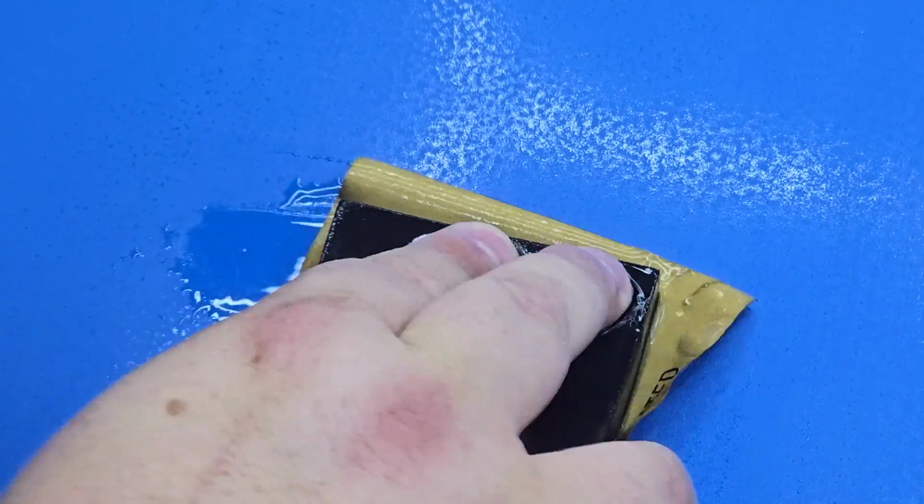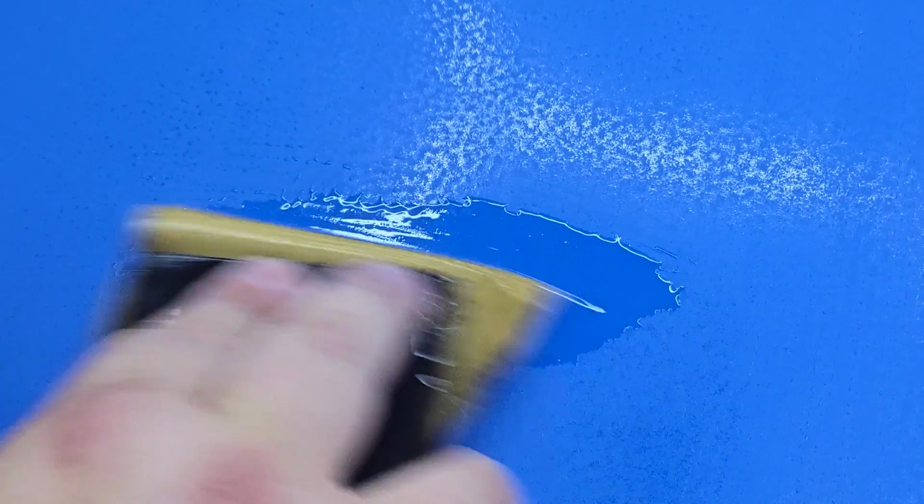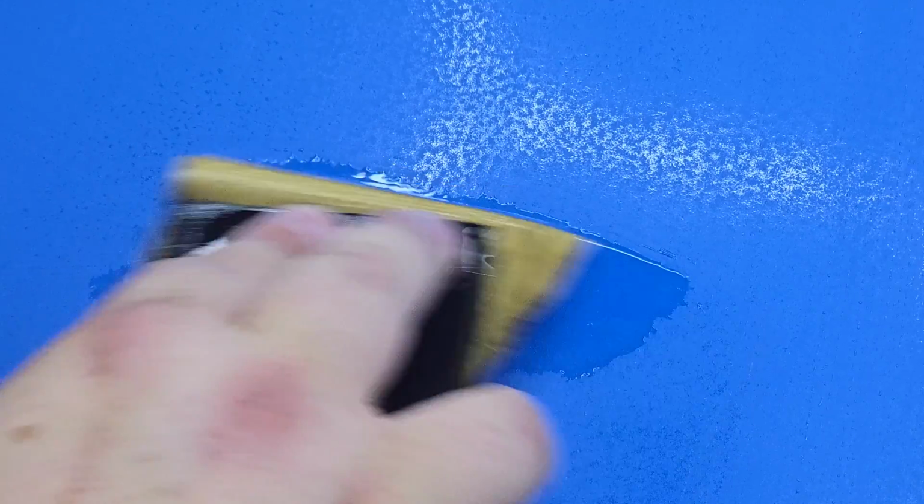And like I said, I've been sanding on this panel. It don't take much. Just let the sandpaper pretty much ride over top. Do the cutting. You wipe away. Look at that. That dirt nib is pretty much gone. You don't see no outline when you cut and buff. And like I said, we haven't even done 2,000 or 3,000 yet. So, well, I couldn't even find it. There you go. And that'll be gone. So that's how you get rid of a little bit of trash.